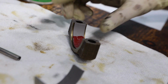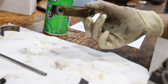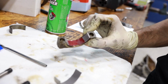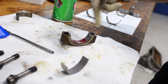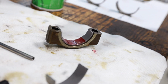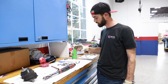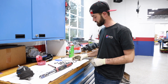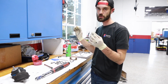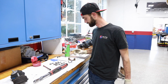All right, so now you got some red stuff on there. What's going on here? This is red line assembly lube. Theory behind this is when you first start cranking your motor over, after you've replaced all your bearings, you've got no oil in there. You've got no oil flow. So this gives you that momentary protection on first startup, so you're not damaging your new bearings. As soon as oil pressure builds and starts flowing, this stuff just gets washed away, and see you later on your next oil change.